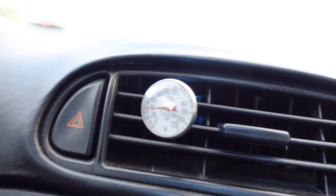Got the AC up and running now. Got it charged up with 1.6 pounds of Freon and look at that - it's blowing 39 degrees, 38 degrees. Man, it feels great in here with the windows up. If you guys are replacing your AC compressor on your C5 Corvette, I definitely recommend removing the passenger header. It's a lot easier than removing the rack and lowering the subframe and all that nonsense. Just take off the passenger header - it takes less than 30 minutes - and the compressor comes out like you saw, takes no time. If you found this video helpful, please like and subscribe. We'll see you guys in the next one.